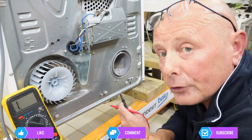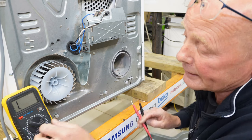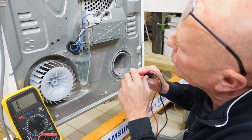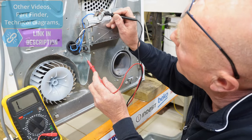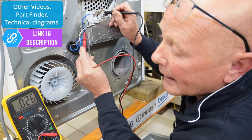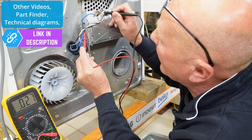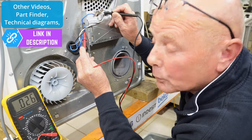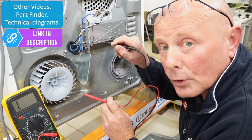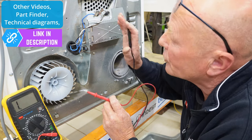We also want to check the heating element. It does state on here that the heating element is 1900 watts. So I'm going to change my meter to ohms reading on a 2K range, and I'm going to go from this connection point to the gray wire. As you can see, we've got a 27-ohm reading. Using the ohms law calculator — which I will put on the web page for you — 27 ohms is approximately 1900 watts of energy at 240 volts, which is all correct.